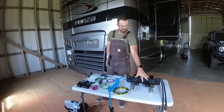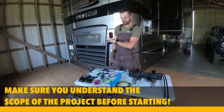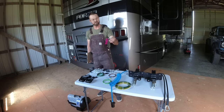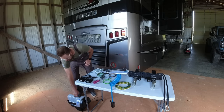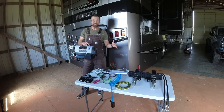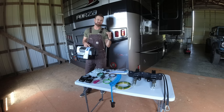These are the actual base plates that are going to be mounted to the front of the vehicle. On the front of your chassis, you're going to take these safety chains, wrap them around your front axle, and connect them to your base plate. Then there's wiring — electrical that connects from the RV to the actual tow vehicle. This is your emergency release, your brake release. If something were to happen while you were towing, the brakes will actually turn on your tow vehicle and stop it for you. And last but not least, this is the Blue Ox Patriot 3, their brake booster. It goes inside the Bronco, and as I hit the brakes on the Winnebago Forza, it will engage the brakes on the Bronco so the tow vehicle stops in unison with the RV.